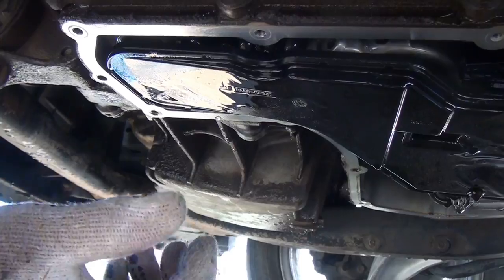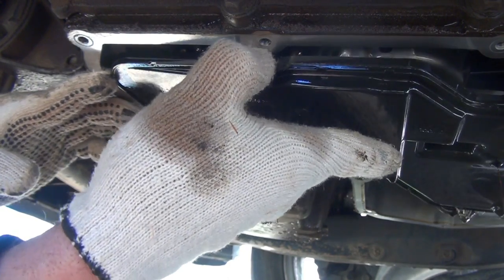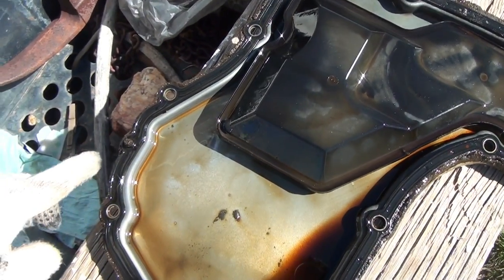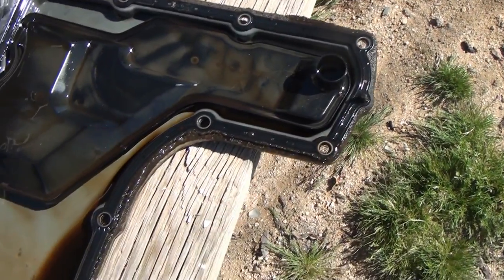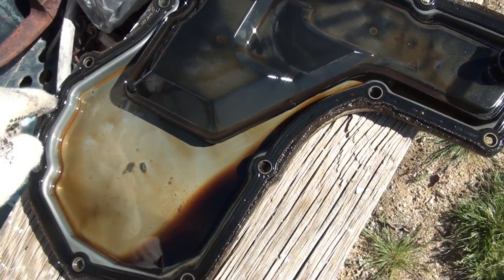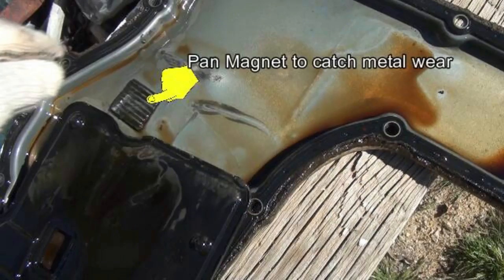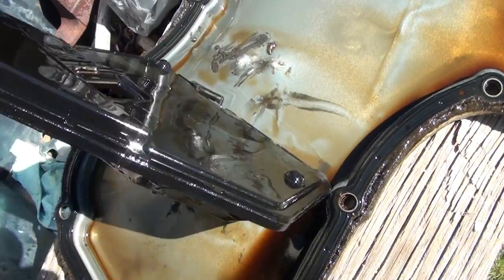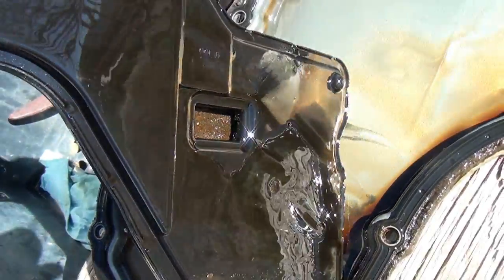The oil filter is right here once you remove the pan — I cleaned up around the edge a little bit. The filter sits right up in here and it just connects right here and pulls down like that. Here's the old transmission oil pan. The original gasket has little nubs that help hold the gasket in the proper position when you push it up into the transmission. This is the old transmission filter, and you can see where the last owner hit something — it hit the filter a little bit but didn't do much harm. You can see the filter looks pretty grungy and the fluid color isn't really reddish anymore at all.